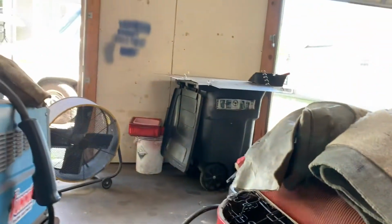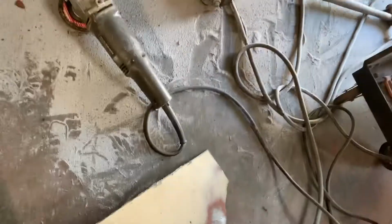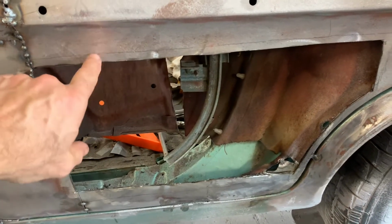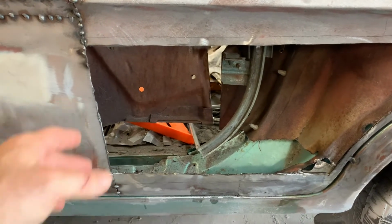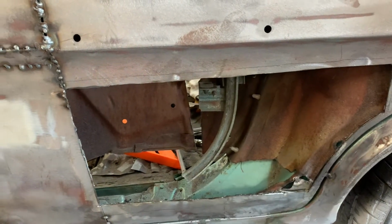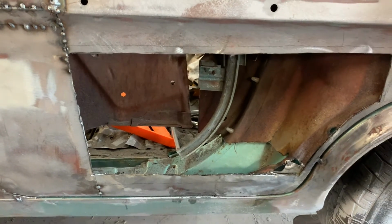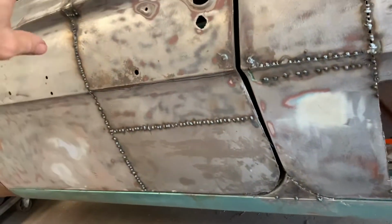And this one's pretty solid actually, but it is just beat up. Somebody's really beat on this thing with a hammer, so we're gonna replace it. So what I did is I went over to my 18 gauge over there, and I traced out this one, and I'm gonna cut that out, and we're gonna put it on here. And I may just tack it in place in a couple places to hold it, and then trim through both panels so I get a good line that'll meet all the way around to weld that, so I don't have a bunch of gaps and stuff. And then while I'm spot welding that around, then I can go around and spot weld some more on these things, which most of these are just about done. And okay, so let's cut out this piece of metal.